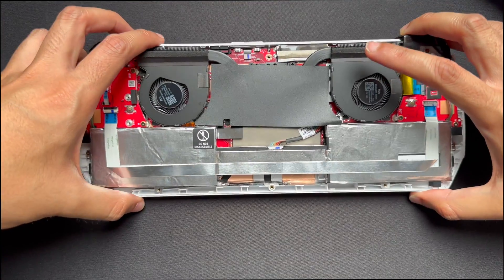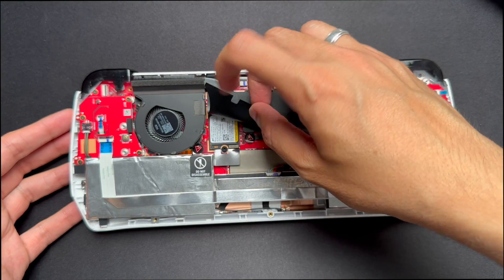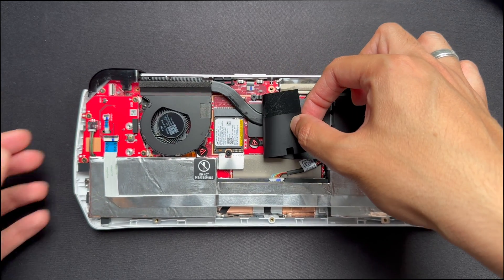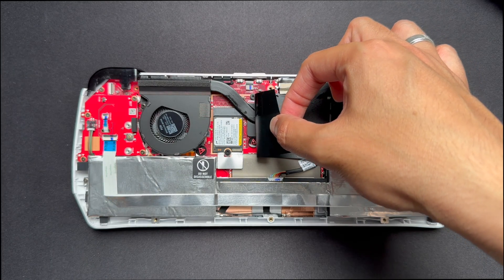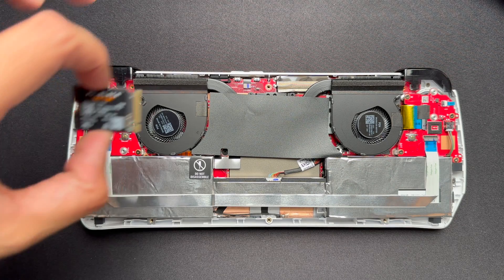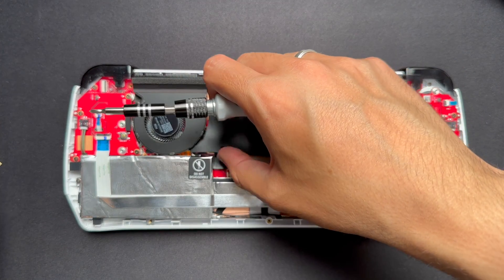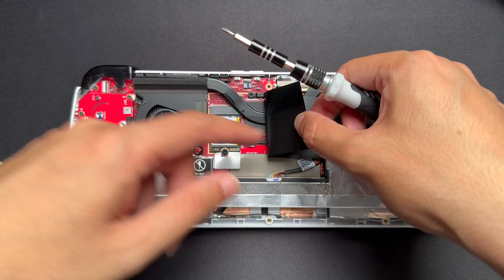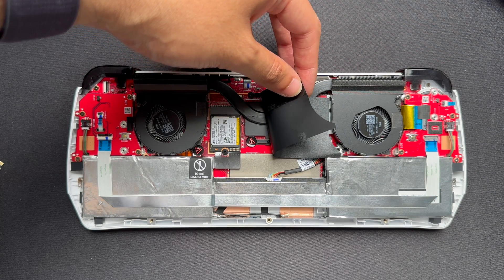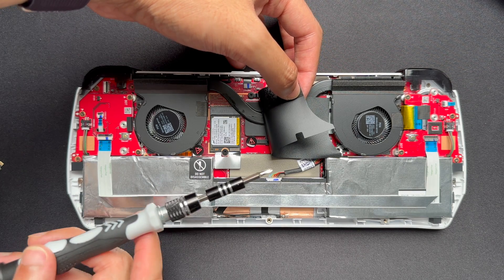As you can see, this is the back of the ROG Ally, and what we're focused on is this compartment here. You can actually pull this to the side if you wanted to, and this is what we're going to be focusing on. Let me just get the SSD — it's quick and easy, we've got our SSD right here. All we need to do is lift up this cover. You can disconnect the battery if you want to — it's totally up to you. Since it's a straightforward SSD swap, I don't believe it's necessary, but for safety you can always disconnect the battery.